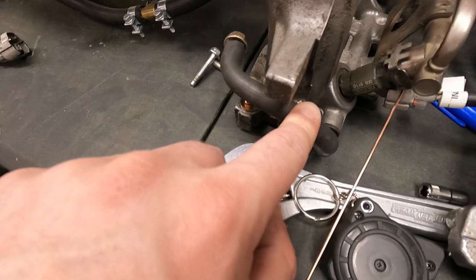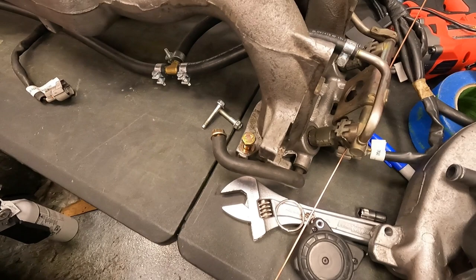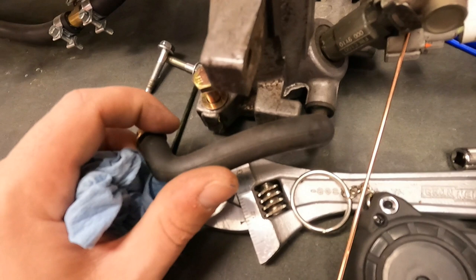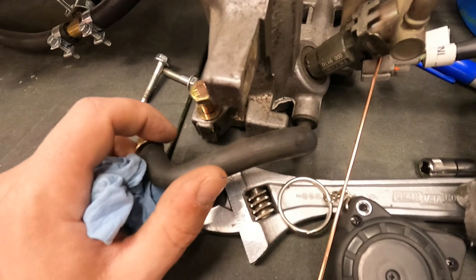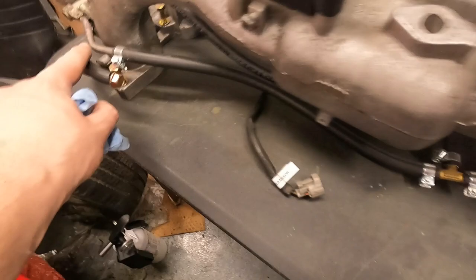So on this intake manifold, on this version of, I think it was either an EJ253 or 251 that the heads and the intake manifold came off of, you basically have a solenoid that injects air, I think to help with emissions or drivability. We don't need it. So we'll figure out a way to plug here. I think I might thread here and put just a brass plug in, and there's one on each side. So we need to do that.